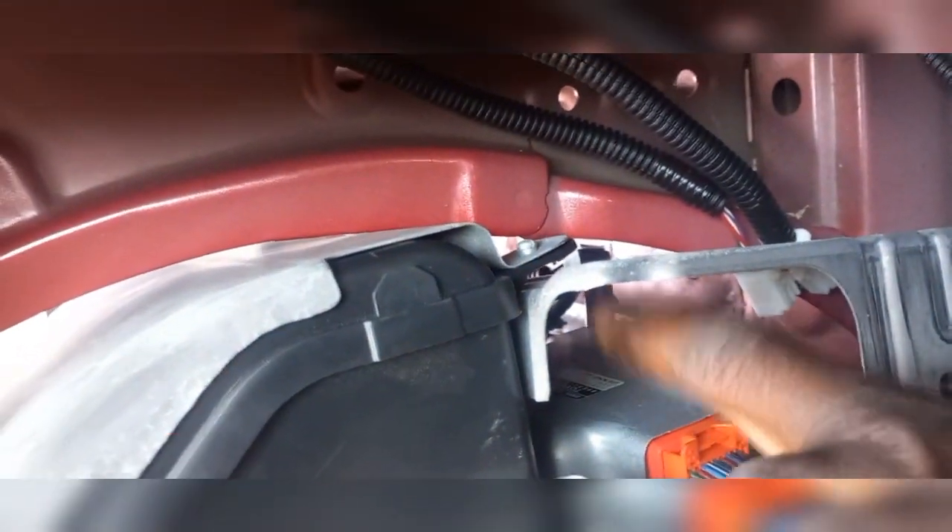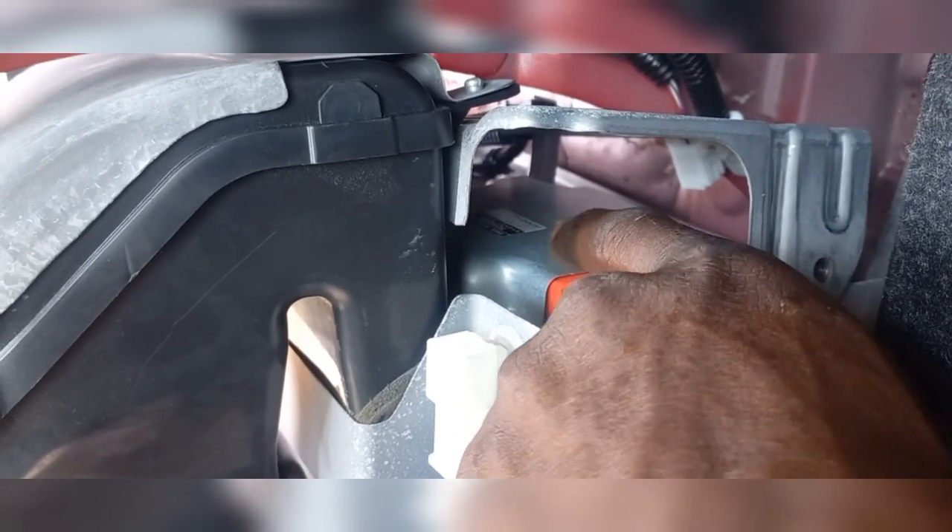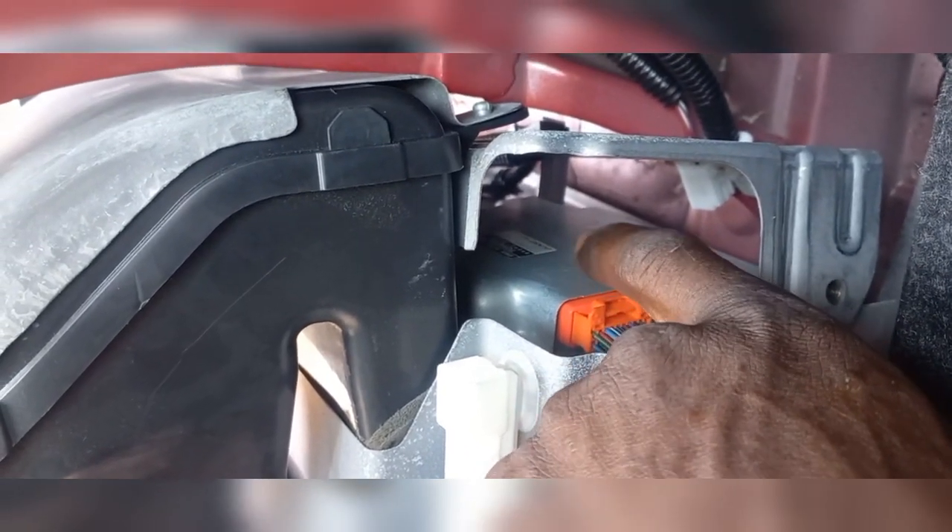Let me go inside the car. It's just me here and I've gone inside and I've taken out quite some bits, so there's no room for me to take out this plastic. I think if I take out this back, there'll be more room for me to actually find a way to remove this shield here. This is what I want to replace — this is the battery smart unit, the battery voltage sensor. I think this is what is faulty. I've taken out the voltage sensors and the other temperature sensor wire that's attached to this.